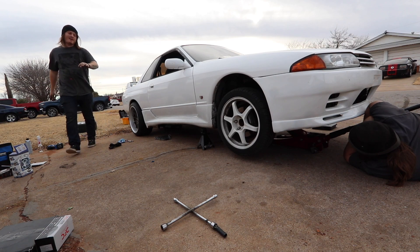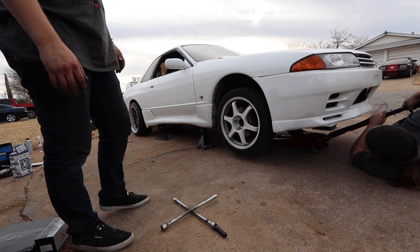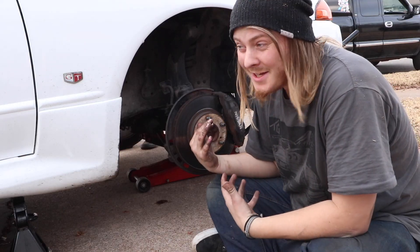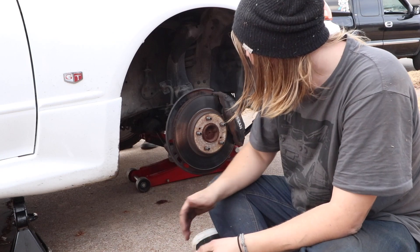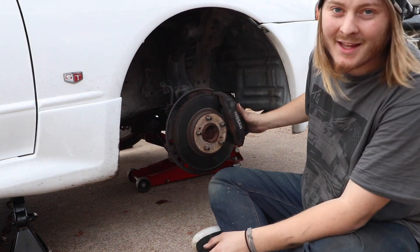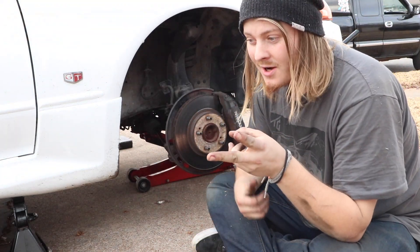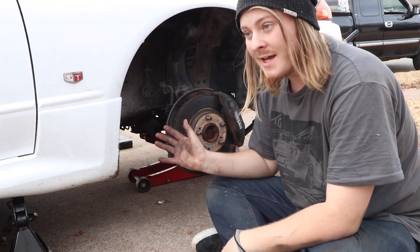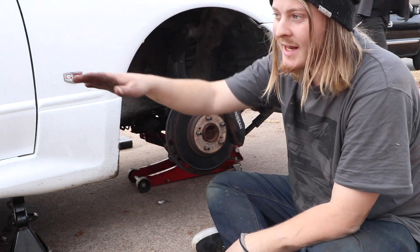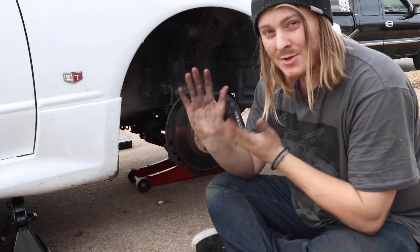So what we'll do is wrap up the front, do two layers on the calipers, take it off the jack stands, then jack it up from the rear diff and do that at the end. We really should have just started this at the beginning. The front is literally the same as the rear — so I'm going to time-lapse through everything: take the caliper off, take the rotor off, replace it, put the new pads on, clean everything, then paint the front. We'll do two layers on the front, let that dry, then jack from the rear. Just trying to play it safe so nothing happens to the car.